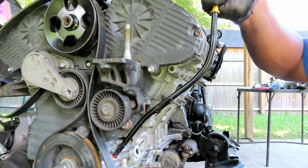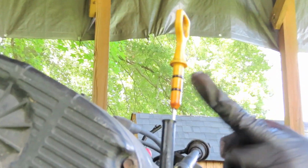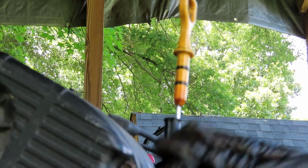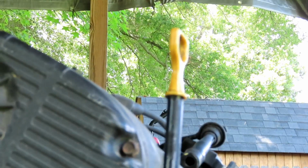And guys, also, check this out. You see these two O-rings right here? This one's set in pretty good. But if your O-rings are worn, change them, because that will give you a P0171 or a P0170, a leak. You definitely gotta fix it. That's why you have those like that. It's not just to escape oil. All right, so this is good.